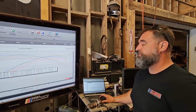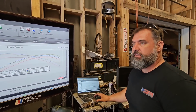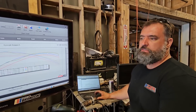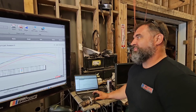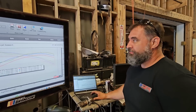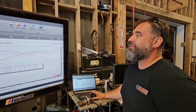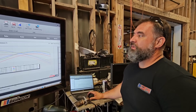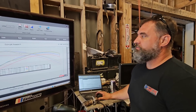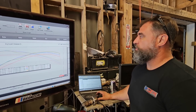And from what we've seen, and testing backed up by other companies, the further it goes, the higher up it goes, the more it needs, the more the MSD shines. And like I said, we're not even offering really any of this ported stuff at this moment in time. So for us, it's really a moot point. It was just to prove the science behind the situation that I had been talking about, that the 1-inch shorter runner, maxed out, it didn't really hurt itself down here, MSD to LT1 or LT2. And it started to pull away up here.